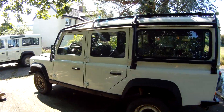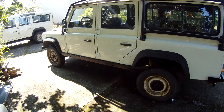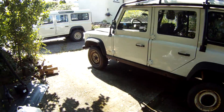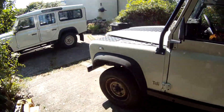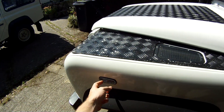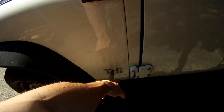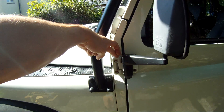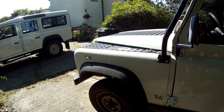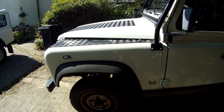This one has been a bit modified. Obviously the first thing is it's got an external roll cage and some rock sliders. These tyres are just for storage so they're scabby but I don't care about them. The most obvious check I always do first is indicators. We've got the oval indicators, which means it's post-2002 to 2009. We've got a TDI badge - I put this one on - and we've got rounded hinges. That's the quickest way to know that it's potentially a rest of the world spec vehicle.